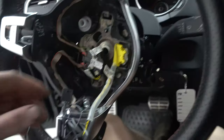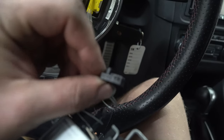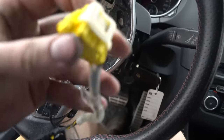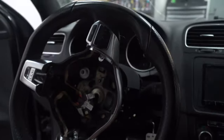Once it's set like this, all you do is you slip out the black clip — pretty easy, duck tail right there. Squeeze the duck tail down and slide out. As for this one, grab the white tab with your fingers and pull back on it. When you pull back on it, it lets go. And look at that — the big cluster ball's out.